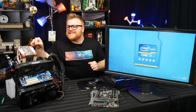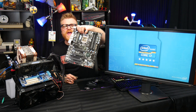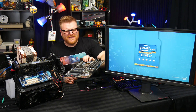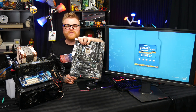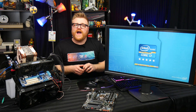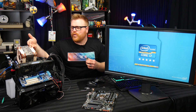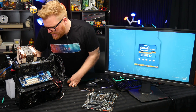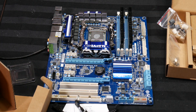This is an 860 and I want to thank Brent who sent me this motherboard and the processor — didn't really tell me it was broken. This is from some oil-cooled PC, and that's a really good EVGA motherboard. I'm really sad I couldn't get it rolling, but the i7 860 that was in it works. I confirmed that with this i3 that the motherboard wasn't the problem. So another viewer, Yuri, sent me this P55 Gigabyte motherboard — the GA-P55-UD4P.